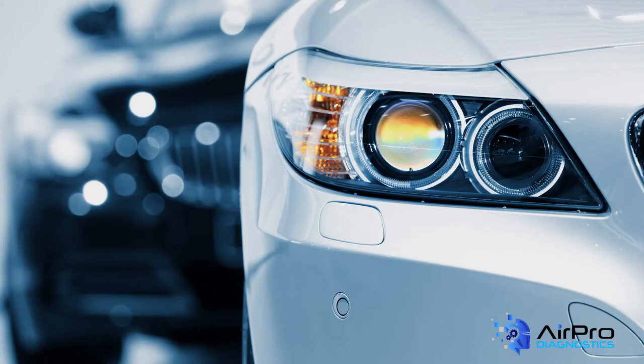Well, testing all lights is a no-brainer. Let's say you find out the headlights don't work. Tracking these problems down requires highly skilled individuals. The DTC indicates a problem in the lighting system. It will take research to find out where all the body control modules are and start troubleshooting to find this specific issue. The problem may be that a body control module in a quarter panel is connected to the vehicle's lighting system.